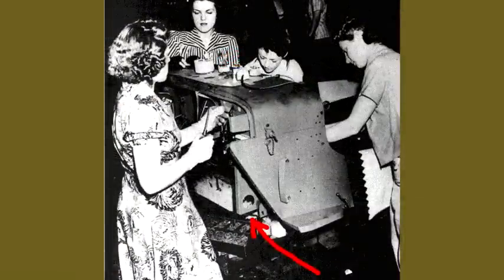The toe board gussets are two triangular brackets used to attach the front of the body tub to the frame rails. You can see the driver's side gusset in this Willys factory photo. Gussets were different designs for MB and GPW bodies. The body tub serial number, if any, will be stamped on the driver's side gusset.